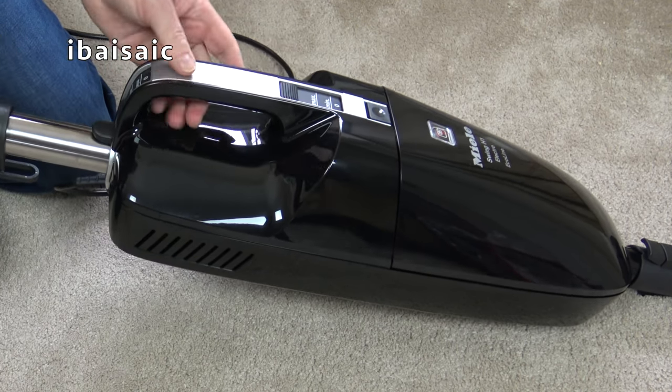So this is the most basic and smallest of Miele's Electro Heads, the Electro Comfort. It's a design that's been around quite a while. I think the brushes feel a bit stiffer than I remember, certainly a little bit stiffer than you'd get on a turbo brush. And in fact, it's not much heavier than an air powered turbo brush, but of course this incorporates its own motor, and it is, did I say it was 150? No, it says it's only a 50 watt motor. That's a 50 watt motor inside. But it doesn't matter if the suction depletes on the machine, this will still rotate at the same speed.